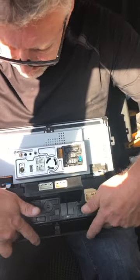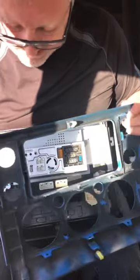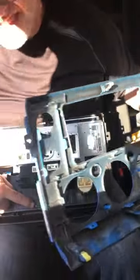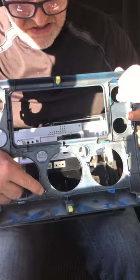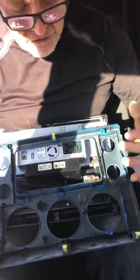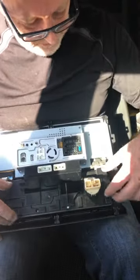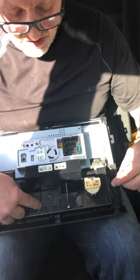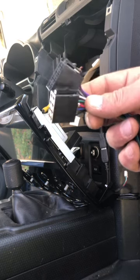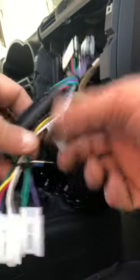By the way, you don't have to take this to bits. There's a bunch of tabs around on the original — you'll see these tabs, pull them out. There's one screw here, you'll see it down here, that you need to undo. So undo that, and you pull the whole thing out once you've disconnected the tabs. Pull the whole thing out after you've disconnected the ribbons, obviously. Push it in here — the same tabs, same screw hole. These plugs come with the head unit and they fit perfectly into the FJ Cruiser loom or wiring harness.